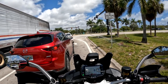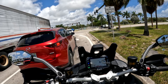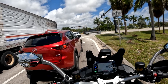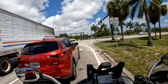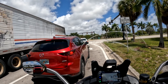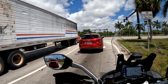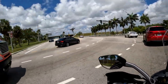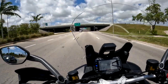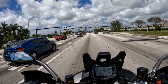This bike has great braking power. The Brembo brakes certainly do their job, and because this is a lighter bike, I tried some emergency stopping and it worked really well — it felt smooth, comfortable, not jerky. You can do really good progressive braking here. It does have cornering ABS and regular ABS. When I did my emergency braking, I didn't feel the ABS kick in at all — normally you get that shuddering movement, but with progressive brake pressure using front and rear brakes, I never triggered it.